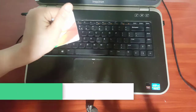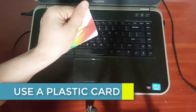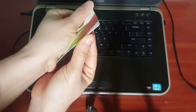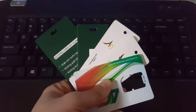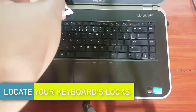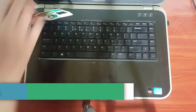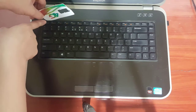Now let's open the keyboard. This is my Dell laptop keyboard. The way to open it is quite easy. First, we need a tool — the tool I'm using is a plastic card, this is a SIM card holder from when I bought the SIM card. You can use any kind of available card in the same style to open the keyboard. Next step: locate your keyboard's locks. Those legs are the locks for the keyboard. For this Dell laptop, we have five locks on the top and five locks on the bottom of the keyboard.